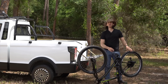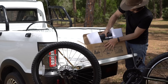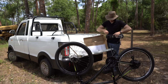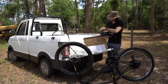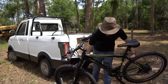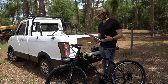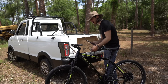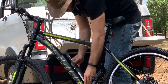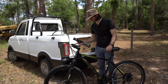Now that we've got the motor on, we can look at the battery and controller. A nice thing about this kit is they're actually combined, so it's one less part to install. Inside is the controller and wire connectors. Let's open up the mount and flip the bike back over. It's not a terribly heavy 500 watt motor. Now this is the moment of truth to see if the mount for the battery lines up with the water bottle bosses — and it's looking like they're not going to line up, and they definitely do not. So that's initially a little bit of a problem.